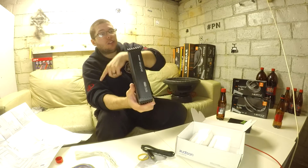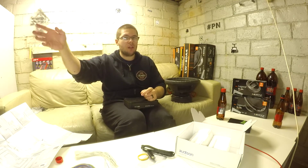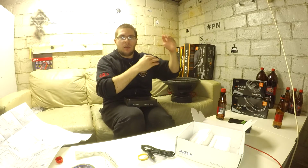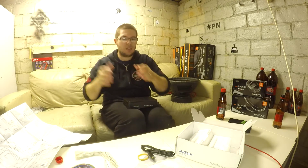Also, after the measurements, you can tune it very, very precisely. I usually take rough measurements, put them inside, and take a song that I know. Actually, I use Katie Melua, Nine Million Bicycles. I know where the singer should be. I should be squeezing her nose, like in that range. So I put tweeters only on. After I put in the rough time alignments, I put only tweeters on and check, okay, she's around here, so I need to change this a little bit or that. Okay, now it's center. Then I go mids only. Okay, she's there, she's perfect. I put the mids and tweeters on and check if the width of the stereo image is right and the singer is where she should be.